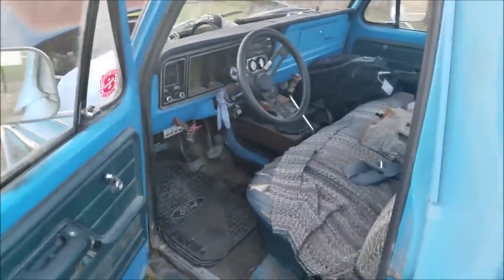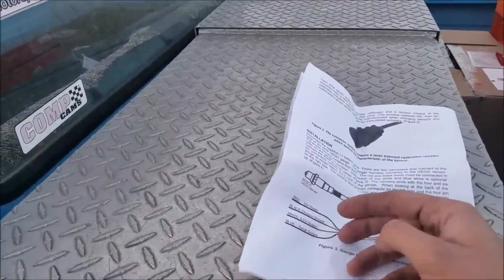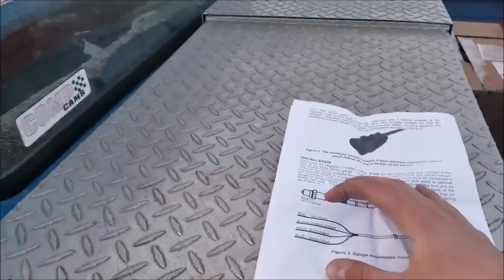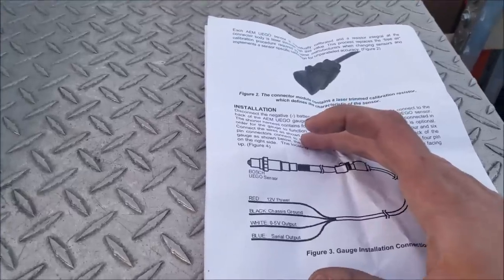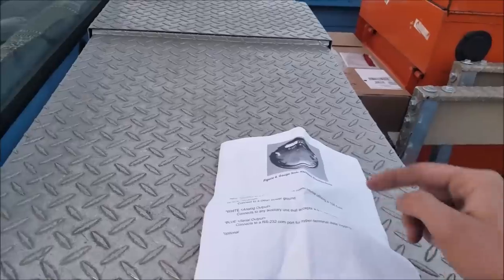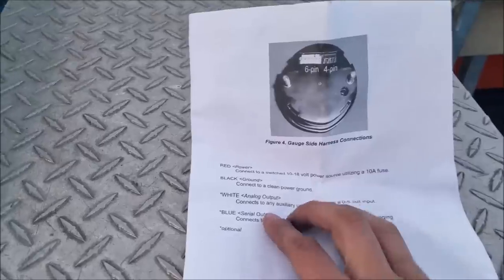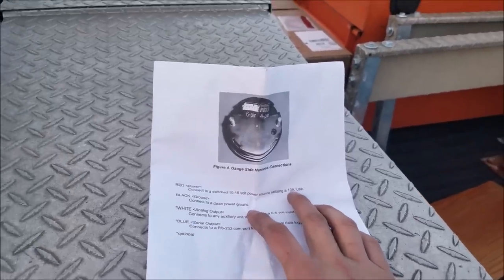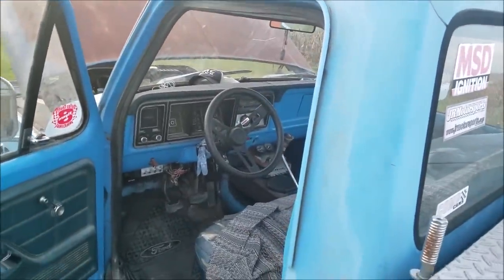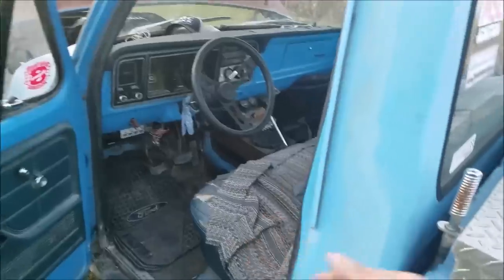Looking up in the truck, the last piece is the wiring, which is really nice and easy. You just have two wires — red and black — as is typical with your 12-volt stuff. Your black is your ground, hook it to any ground you want. Your red is a 12-volt power source. AEM has pretty good installation notes to assist you. The key note to keep in mind is that you want to hook to something that's a 10-amp fuse and a switched power source, so it's not on when your truck is off and not running. A switched power source of about 10 amps and you're good to go.